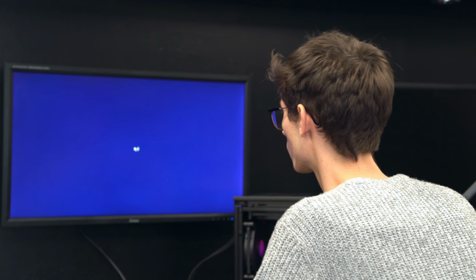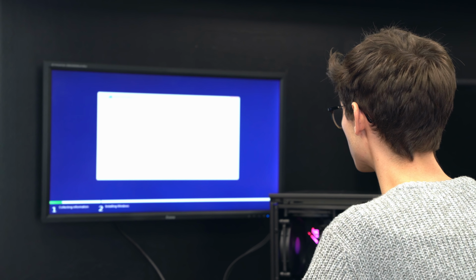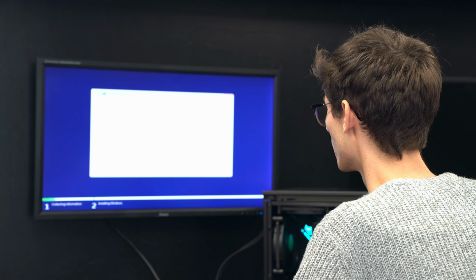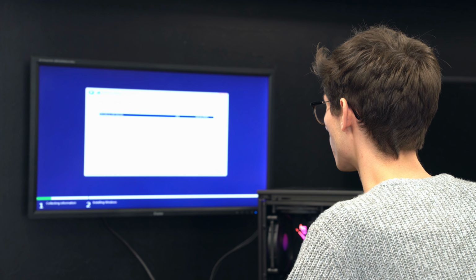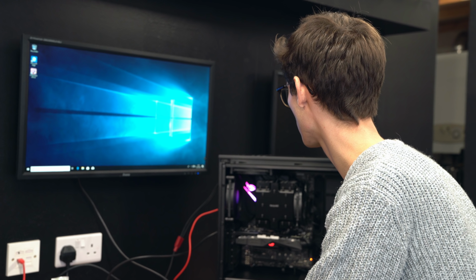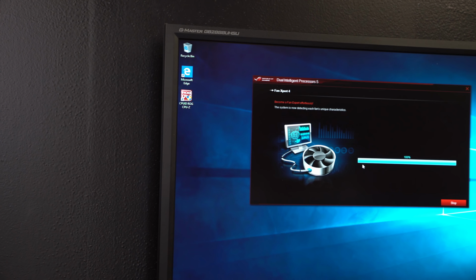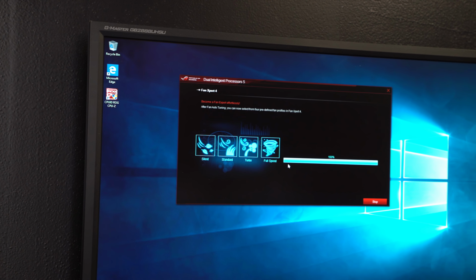You obviously will eventually if you want to activate Windows, but for the time being, I would advise just clicking on "I don't have a product key, buying it later" just so you can get set up and running. And so before we actually overclock the system, something I always quite like to do is install the motherboard software that controls things like the fan speed. Because we've got an Asus one here, we're using AI Suite.